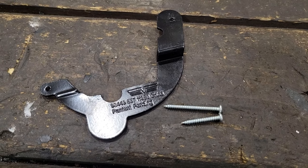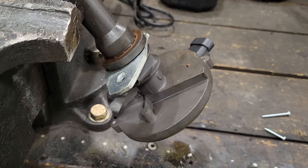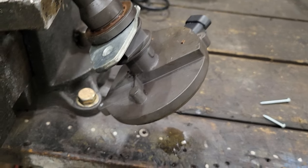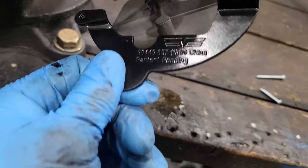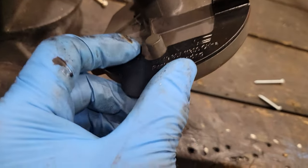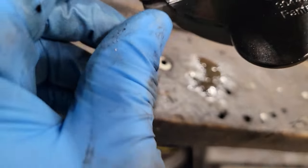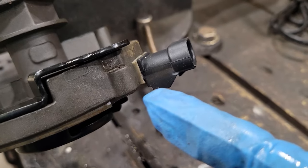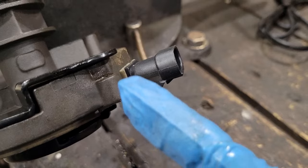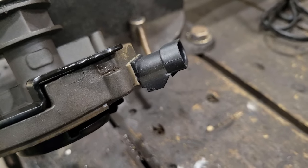How does that work, you may ask? Well, let me show you. You don't have to take your distributor out to do this — I just figured it makes the video a little easier to see. This plate goes on the bottom of your distributor. You line it up against the dowel and the body, and your hold-down bolts or screws for your distributor cap line up there. So even if that ear is broken, the screw will go through the cap right into this plate, holding everything securely in place, so your timing's still right on.